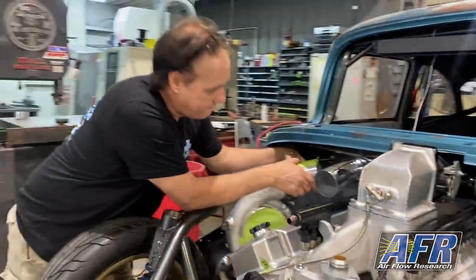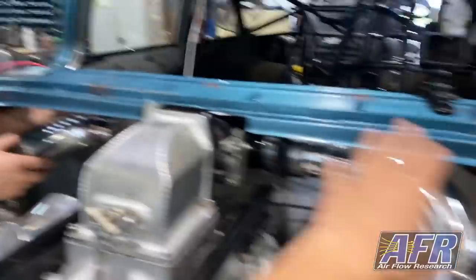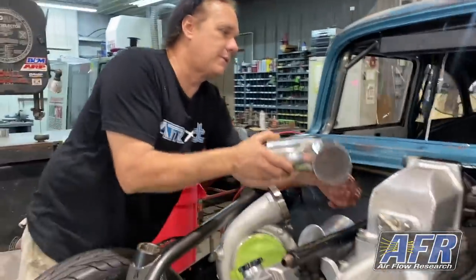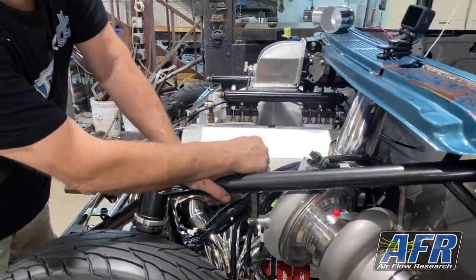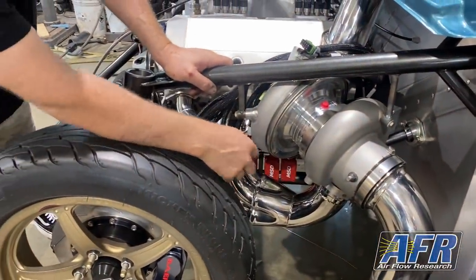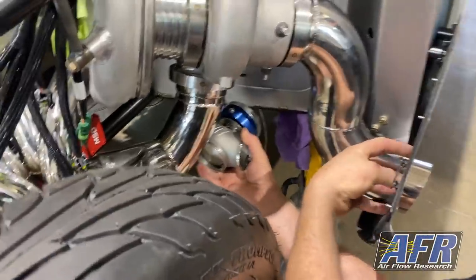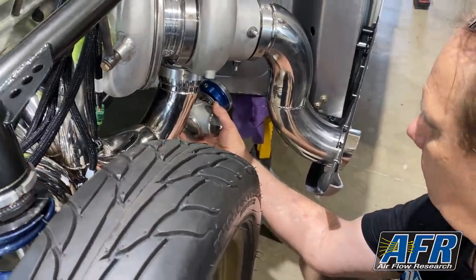Checking out what's going on — you've turned this around so that way you can make these tubes. All right, so what I am doing is trying to finish the hot side. Look — downpipe, headers, they're complete with the exception of EGT sensor bungs, O2 sensor bung, and then wastegates. They're pretty cool, everything's working out so nice. The big Turbo Smart is gonna sit right here and come out with the exhaust port. It just lines up — that's nice, just works perfect.